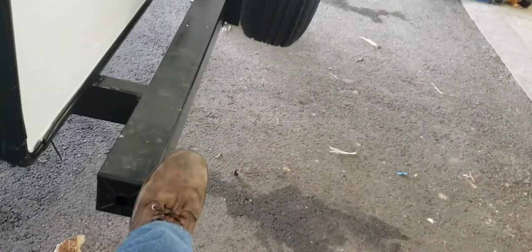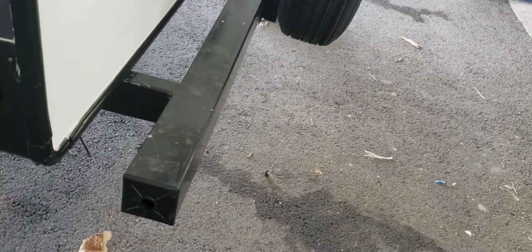I recommend doing your black tank first, letting that get dumped, then doing your gray tank. The gray tank will flush out your sewer hose, so when you pick it up to move it around, it's not dripping black tank water. Speaking of sewer hoses, a perfect spot to store that is in the bumper cap.